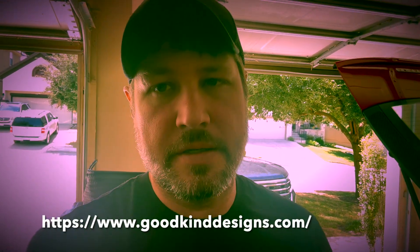Shout out to Eric Goodkind of Goodkind Designs, who pointed out there's actually a filter in the power solenoid block area — just a $12 strainer basket filter that a lot of people don't even know is there. I didn't know it was there. I need to go pick one up because Ferrari is on summer vacation and nobody has it in stock. When we bleed the system, I want to make sure everything is clean and swapped out, including that filter.